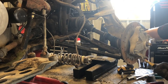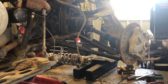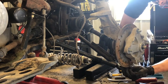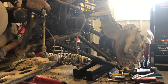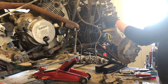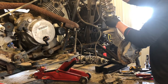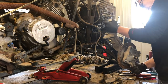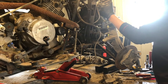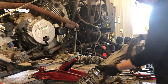Then I take and just tap on the A-arm — make sure you don't end up hitting the boot otherwise you're gonna rip it. There you go, it pops right out that way your boot doesn't get damaged. You can see there's no rips or tears in the boot. This one does seem a little loose so I might go ahead and pull this entire spindle anyway. There's a 19-millimeter up top — I go ahead and hold this shaft up and use my impact to remove that 19-millimeter nut up top, still hanging on to the shaft so everything doesn't just drop. There we go.